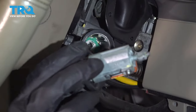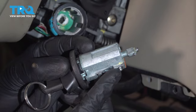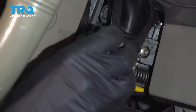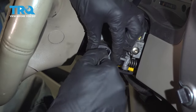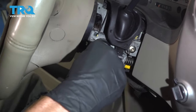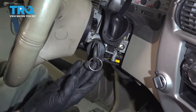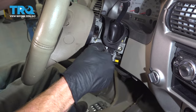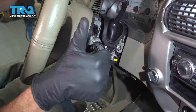All you need to do is take the ignition cylinder and have the little ball facing down so when it goes in it'll lock into position. Twist that around a little bit, press it in. Go ahead and try to tug it out of there — we want to make sure it's completely locked. You don't want it falling out while you're driving down the road. Go ahead and turn the key and make sure it functions properly. Thanks for watching.